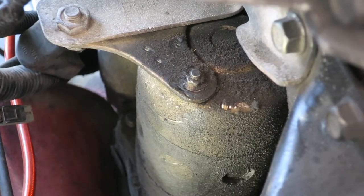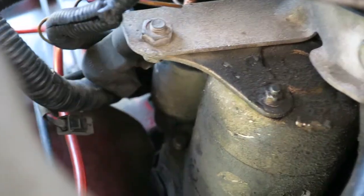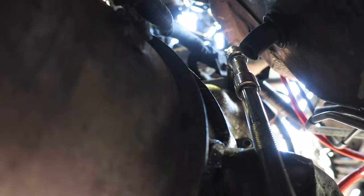You can see we got that bolt off - that bottom cable just disconnects very easily. I only did that with one finger actually, and then this cable should slip right off the stud. We're gonna remove that 8mm nut right there in the center - that's being attached to the front support of the starter. There's a whole bracket attached. We're gonna go ahead and remove that. After breaking it loose, we're able to just twist it with just a socket and that nut comes right out.